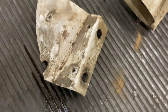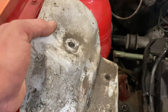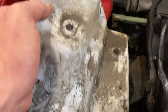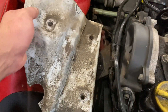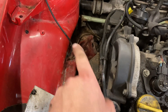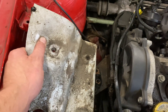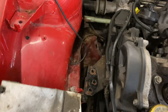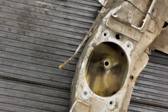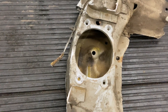It was chucking it down raining outside so I didn't go out with the camera. Basically I've chopped those parts of the chassis legs off which will overlap, and mount where we need to be, so we've got the mounting point of where we need to be with the chassis. There's a bit of grafting to do. What we're trying to do is take as little as possible out of the original, overlap it, and then seam weld it both sides - underneath and on the outside as well. We've got the same on the gearbox side, because I want this mounting point and hopefully I can piece it in somehow. We will make it fit.